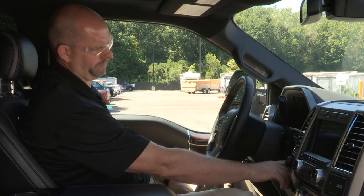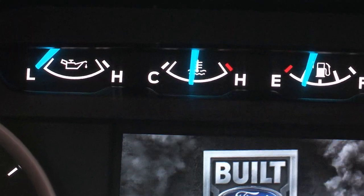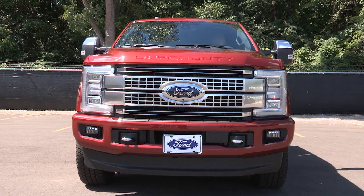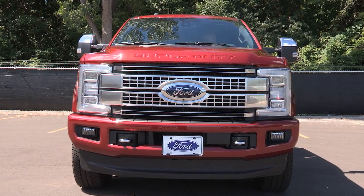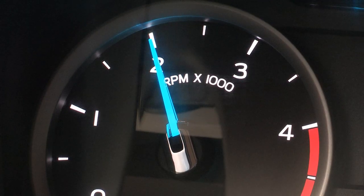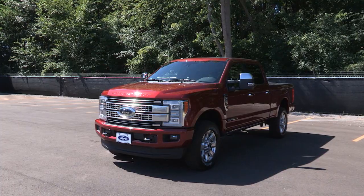These holes introduce fresh air into the tailpipe to cool the exhaust gas as it leaves. Warm up the engine and check your engine temperature gauge to be certain. You can command an OCR before the engine is warm, but you'll have to wait for the process to start. It takes some time at the elevated engine speed to warm the engine up.